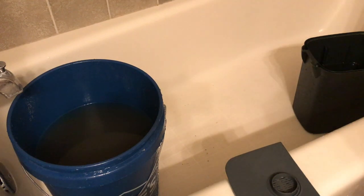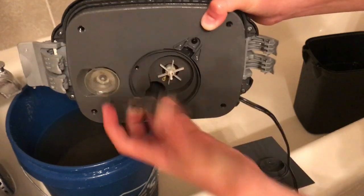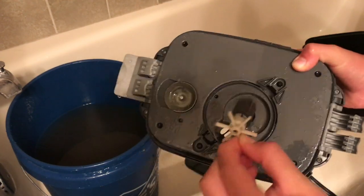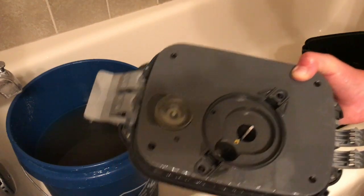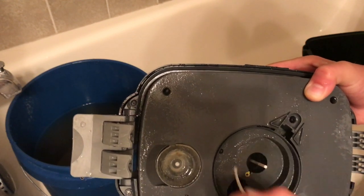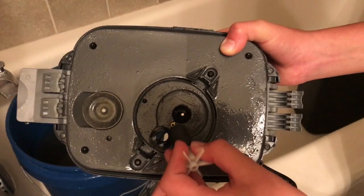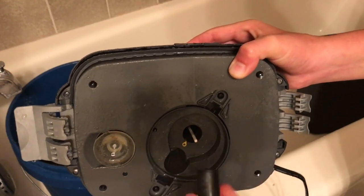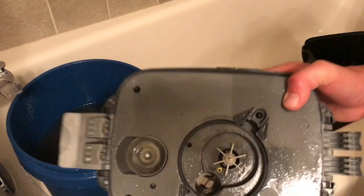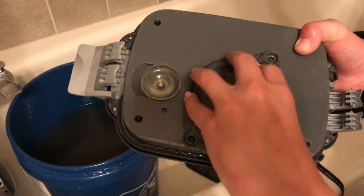This stuff's all clean. Now we'll work on this part. For Fluval, you push these two tabs and this pops off. You really don't have to clean this part, but in here I like to take the impeller out, and then I like to run a Q-tip down in here just to remove any junk on the shaft. Go ahead and clean that up. Same thing with the impeller. Then we'll put it back together. Be careful not to break this shaft, as it is a ceramic shaft and it does snap easily — and then you're out of a filter if you snap it. Go ahead and place this back on. Wrong way — now we're going to start putting everything back together.